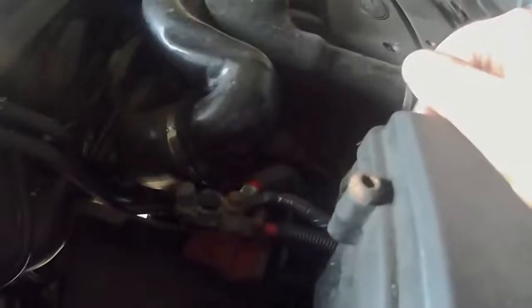The clutch is now working again — hopefully sorted. I finally had to just pump the crap out of it until it was nice and stiff, then push it right down to the floor and hold it there with a bit of wood for two days in the hope it would bubble the air up. It seems to have worked, which is why I've put the battery box back in.